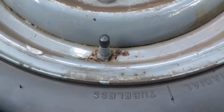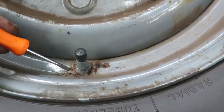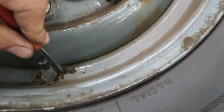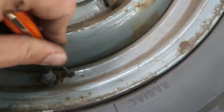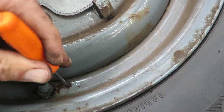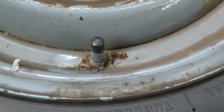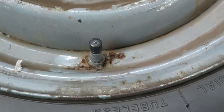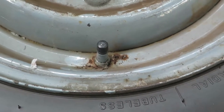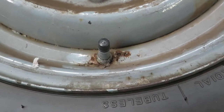Here's another joy of older cars - I just pulled that wheel off and there are nice big rust holes all through it. It's got a tube in it so it's not actually going to leak, but as for structural integrity, probably not very good. We'll probably want to throw that one in the scrap and find another wheel. I'll have a good look at all the other ones too while we're there.